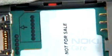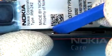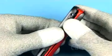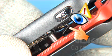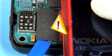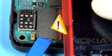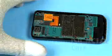Unlock both clips of the A cover with the SS93. Slightly release the assemblies beginning at the bottom side. Note that this small flex connector was opened before continuing. Gently twist the upper assembly near to 90 degrees — the large flex connector becomes visible. Release it with the SS93. Do not bend the grounding clip. The assemblies can be separated now.